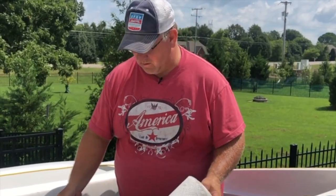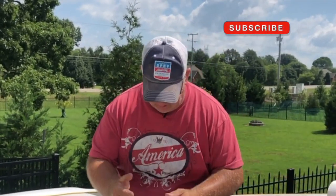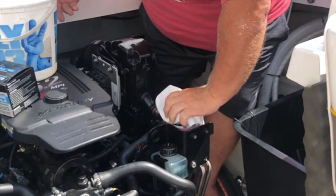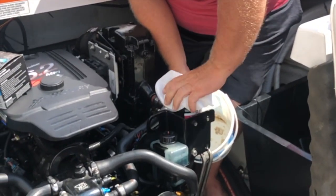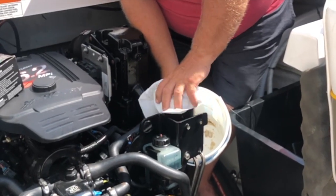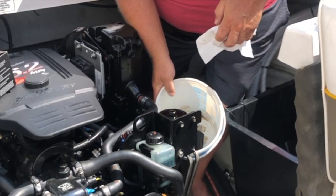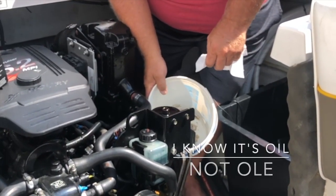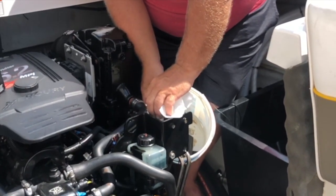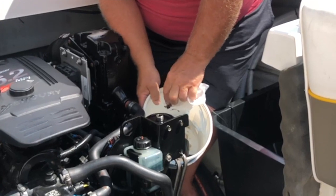You may or may not need a wrench. If you're lucky, you won't — you're supposed to put them on hand tight. So get some paper towels and just turn it and loosen it. Get your bucket ready, go ahead and just take it off and drop it in. You're going to have a little bit of oil up here. You can see this black oil — I'm a little overdue, as you can tell.